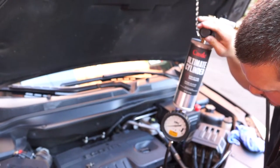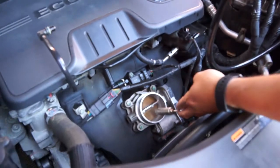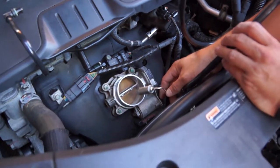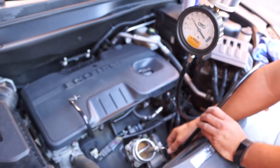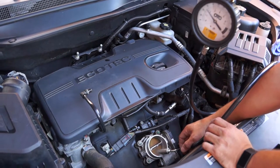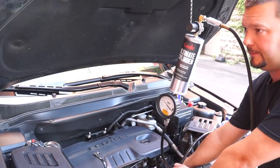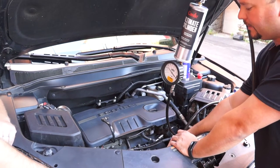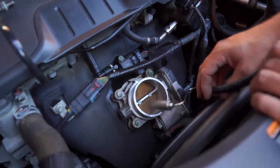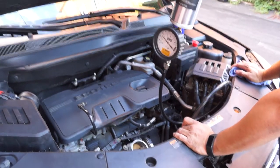Open the tool and raise your pressure. You heard the engine start to slow down a little bit, which is expected. You've got a real fine mist — it's real light. It's going to get atomized through the intake, clean the plenum, clean the back of the valves. This is going to finish what we started with the GDI cleaner. Note your time — it's about three o'clock. 10 to 15 minutes and it should be done. If some guys put this all back together, you won't be able to see the flow — could be leaking out where you don't want it to be. You'll notice the RPMs are coming back up because the engine's running better. We let this run for about 10 to 15 minutes — that's going to complete the job.